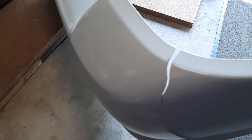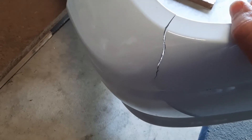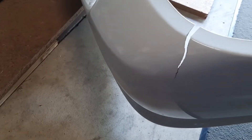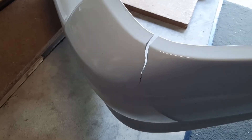That crack isn't going to close up on its own, so I might put the heat gun on it. To avoid painting it I'm going to try supergluing it first and then plastic welding from the back. Hopefully you'll just see a hairline, but that's better than painting the whole bumper bar.